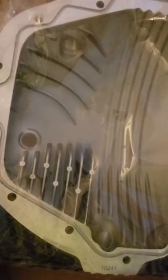trial and error to make sure that you're not just getting some flat aftermarket diff cover that just splashes the fluid around. As you can see, it has the fins to make sure that everything inside your rear differential is getting lubricated. And you can see the machining process, the groove for the o-ring to seal it, and then it's got the cooling fins.